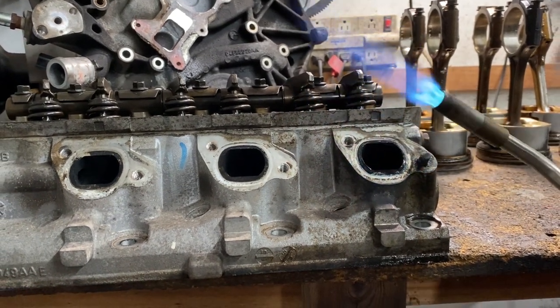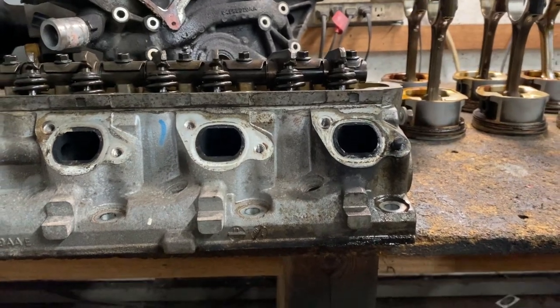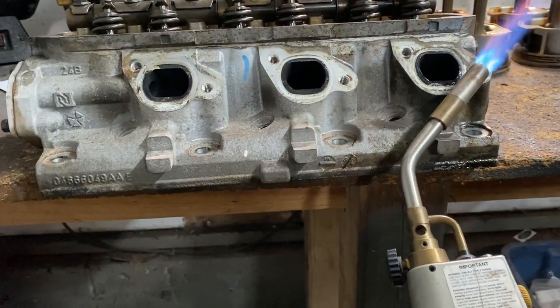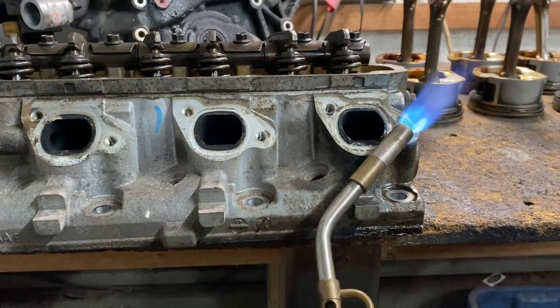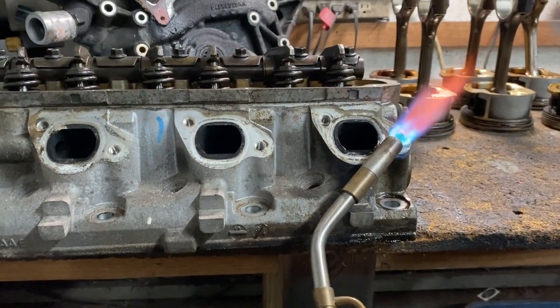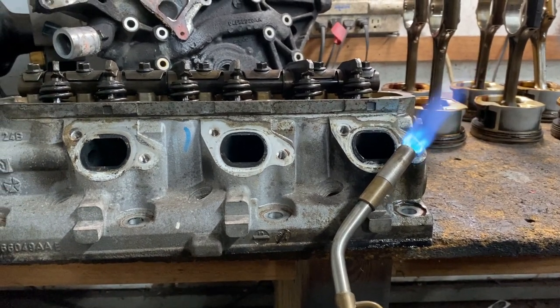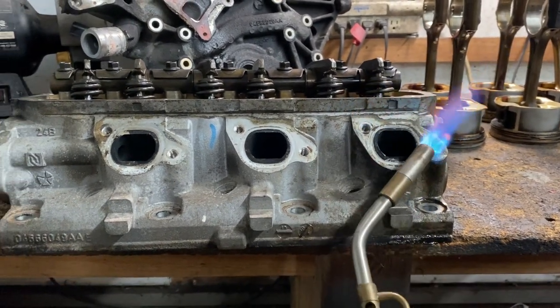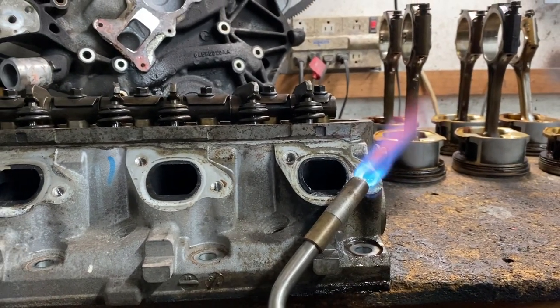Be careful that you're keeping it away — you don't want to really heat the head up too much. This way is even better: you just want to heat up the stud. Get it nice and hot. I already did it, so it's already hot. You can do it for about a minute, but again you don't want to put it against the head — put it like that and move it around a little bit.